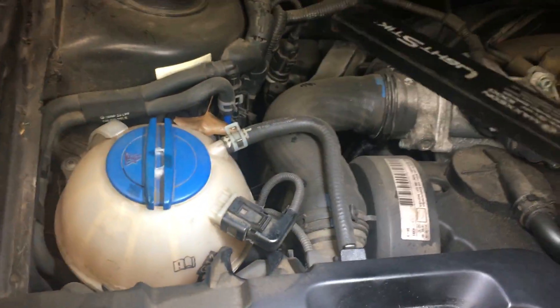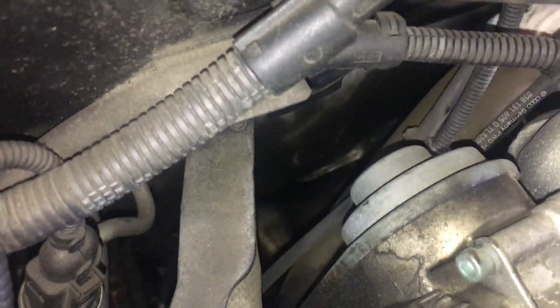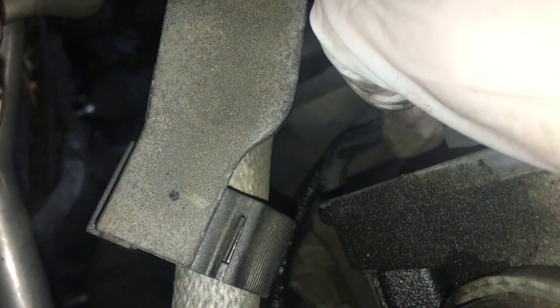The next area where I found a pretty good issue with mine is these vacuum lines coming from the back here, all this stuff. In particular, right behind here — if you follow this line on my car, right in the back next to this throttle body, you can see that the line was smushed against this for a long time right where my finger is. You can tell that most likely is not allowing enough airflow through this vacuum line and subsequently not getting enough boost.